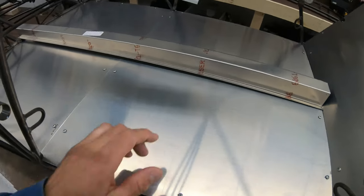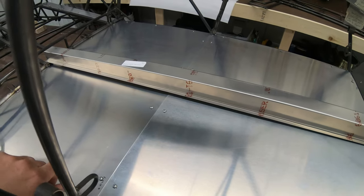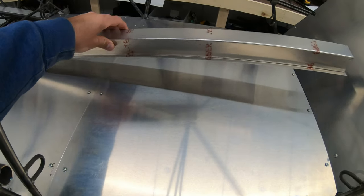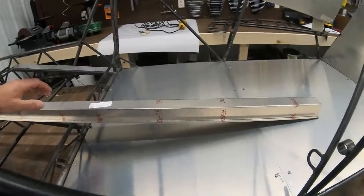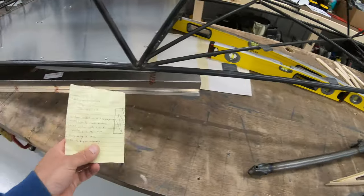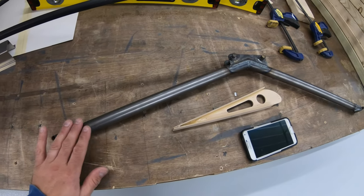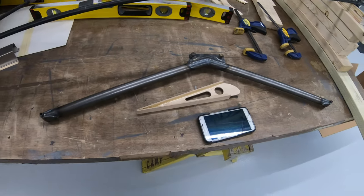What that does is get rid of the cover — otherwise the elevator push-pull tube runs right through the floor in the baggage area, so I will not need that cover. They also welded the elevator guide points below at the factory, and I got the heavy duty V-brace for the landing gear, which will work with the TK1 shocks and landing gear.